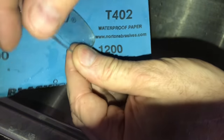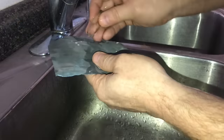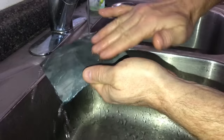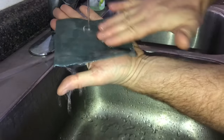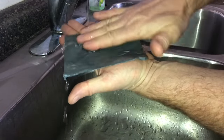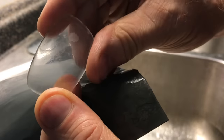In order to get these big scratches off and remove this coating, I'm going to take some 1200 grit sandpaper. I wouldn't go any coarser than this — the 1200 grit is really fine and it will take out these big scratches and get the coating off. At this step we're going to use a little bit of water to make sure it cleans all the debris off as we polish. Just take your time and work it off, and try to work the entire surface of the lens.